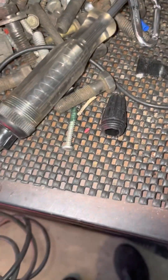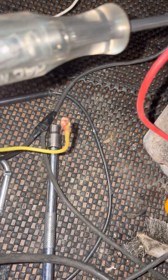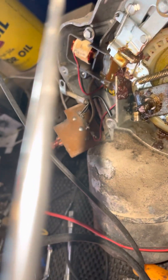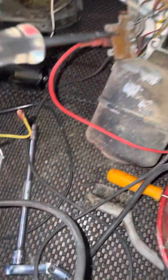Before you even start, I highly recommend you use your light tester. You can check the same ground area or connect it to the other clip — if this is true, then this ground is good, and then you complete the circuit. Take a look at this — this is positive right here. Let's make sure this ground is connected. Complete the circuit — there we go, circuit completed.